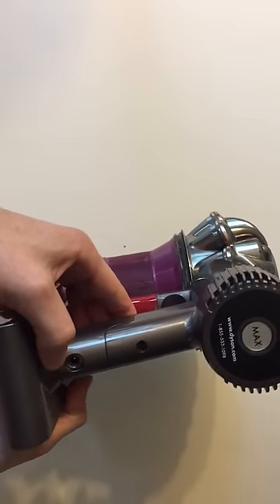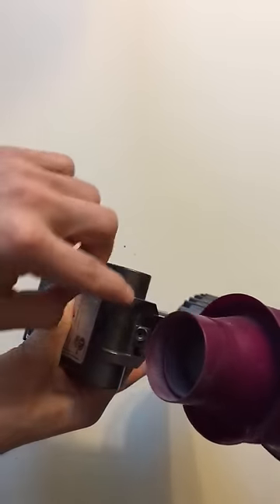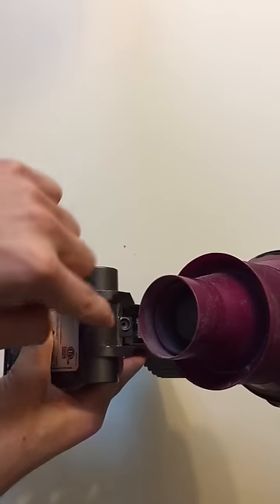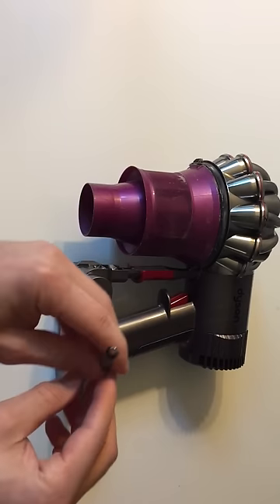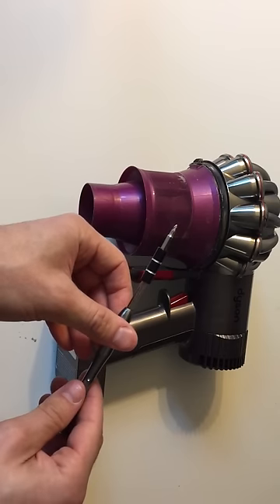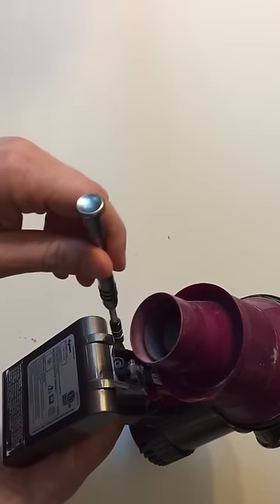Okay, and now to take the battery off it's really simple. There are two screws. That's your charger port, not a screw. There's a screw right here and there's a hidden screw right here on the battery, and it's at an angle so you can get into it with a screwdriver. It's a Phillips head so you're gonna need something pretty tiny — just a little one that looks like a cross.